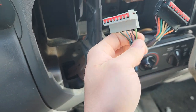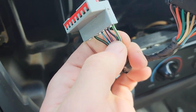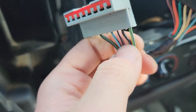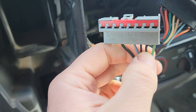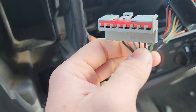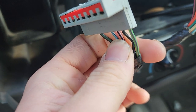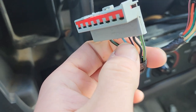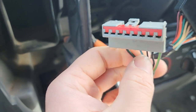This green one here — green with a line of purple — that is your 12-volt constant. Right next to it there should be a solid black wire, no colored stripe, and that is ground. Next, you have a black wire with a pink stripe, and that is going to be your ignition 12 volts — your switch 12 volt that turns the radio on and off with the ignition.